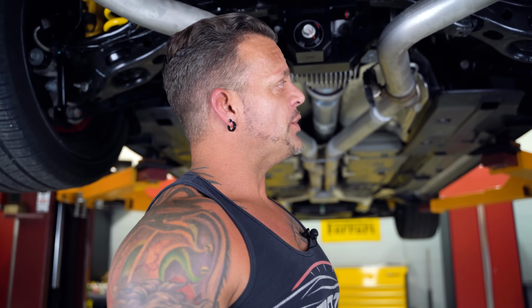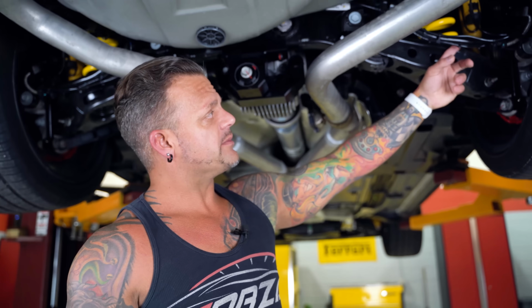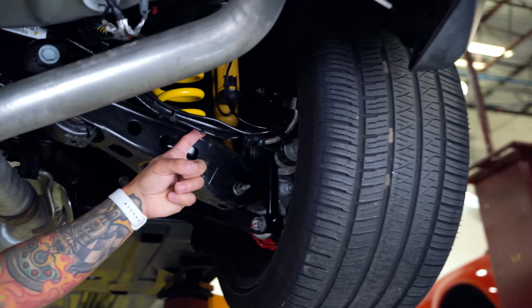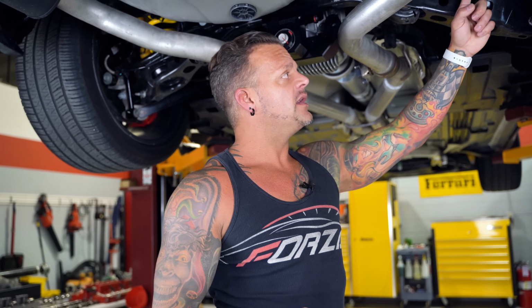And also, when you put the complete package on the car and these tow arms that are coming, which is this arm right here, out in a couple weeks, you're gonna be able to clear a 15-inch wheel. For all you guys that wanna run a 15-inch rear wheel conversion, you don't have to do all that crazy excessive grinding. Literally, you change the rear brakes and the 15-inch wheel bolts right on. Nobody makes a set of arms that come close to doing that, okay?